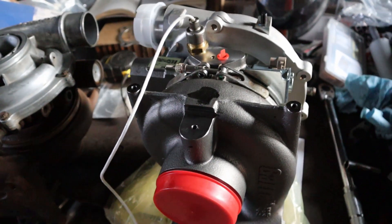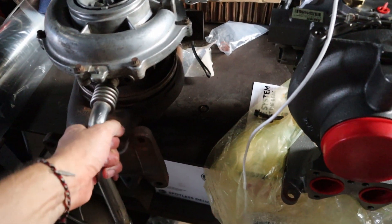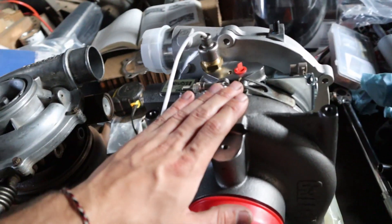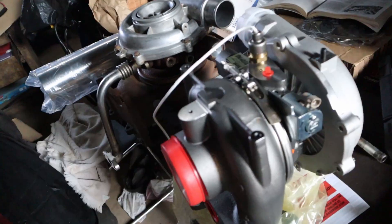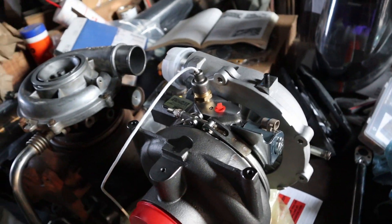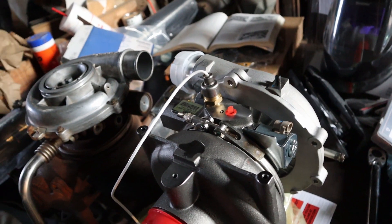I was hoping to get the new turbo put in today, but it looks like we're not going to be able to. I ended up having to order a new oil drain tube for the turbo — this one is a little beat up and kind of squished in a couple of locations. I don't want it to affect the oil flow, so I went ahead and ordered a new one. We are still going to do the remote location for the oil feed so we have cleaner, fresher oil going into the turbocharger, and hopefully it'll last longer and run smoother. We didn't get as much done as I was hoping in this episode, but whenever we get those parts in we will get this thing put back together and wrapped up. Thanks for watching Toss the Wrench — don't forget to hit that like and subscribe button, and I'll see y'all next time.